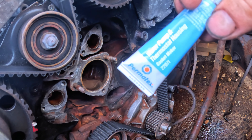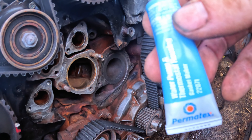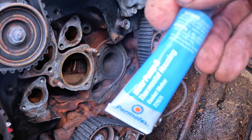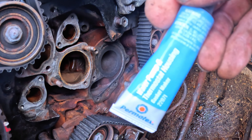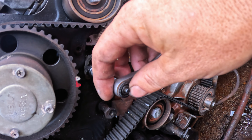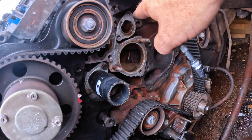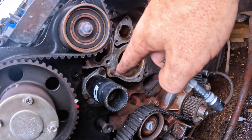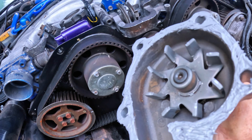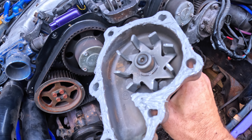What I've got here is Permatex water pump and thermostat housing sealant - the blue version - which is allegedly what this engine used OEM. The instructions say to apply it over one of the mating surfaces, shove it straight on, bolt it up finger-tight, leave it for an hour, then torque it up to spec, and leave it for 24 hours before getting it wet. I went around all the little grooves first, filled those in, then went around everywhere else and smudged it in with my finger.